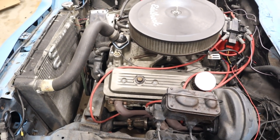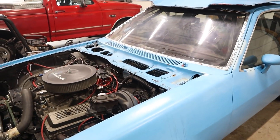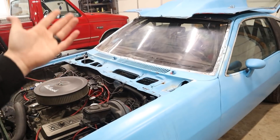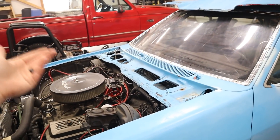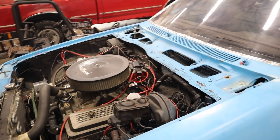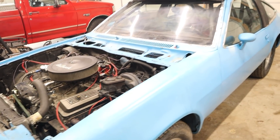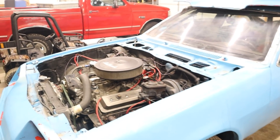That seems to run pretty good. The car with me in it is 2,950 lbs, so it doesn't have to move a crazy amount of weight. After looking at the car, I think with me in it we could get it below 2,800 — there's a lot of weight that could be pulled out of this thing. The Turbo 350 that's in it, he said, was in it when he bought the car — so he just figured run it, see how it does. Like I said in the last video, it seems to do pretty good. I wish it had a trans brake and maybe a higher stall, because I feel like it's like a 2,800 stall or so. It's a fun car, it's a handful to drive — big tires, ladder bars.